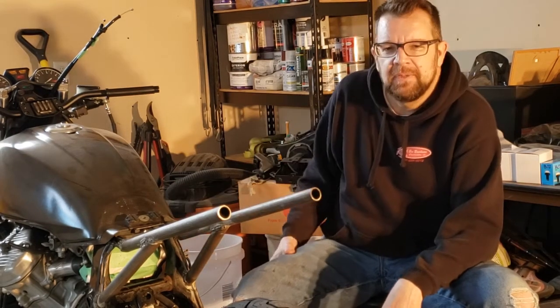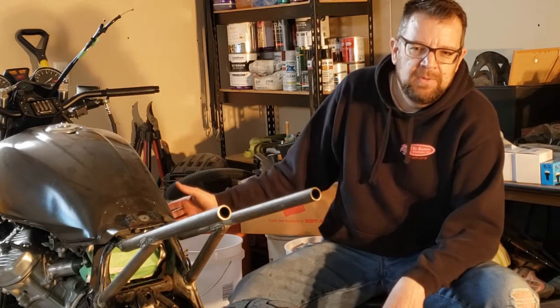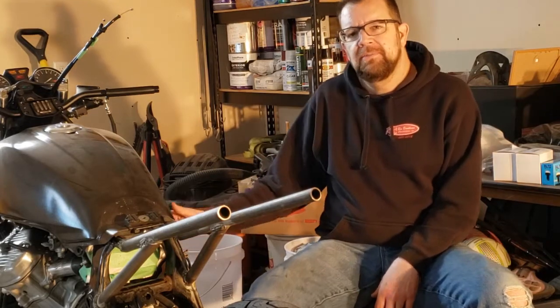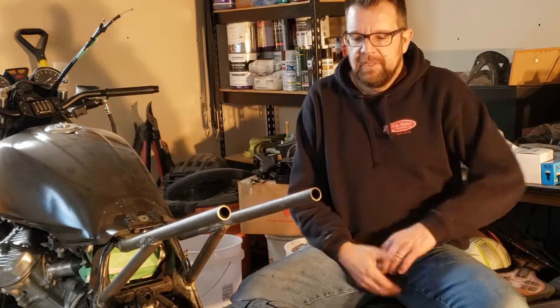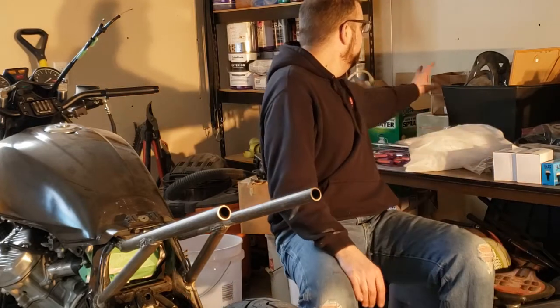And the only thing that I'm missing, obviously we need to do something with the front brake. I don't know if they're just sticky or if they need pads. We'll get to that point when I take them apart. And I figured out where this water's coming from, where it's leaking. So I need to get some new gaskets for that. Otherwise, I think I pretty much have everything I need. Oh, exhaust strap. I don't have that, but what do you got?